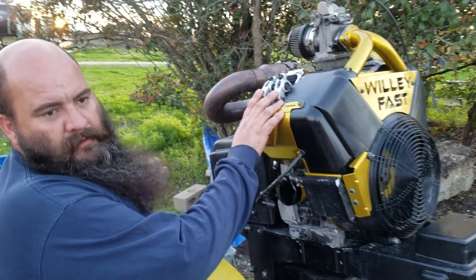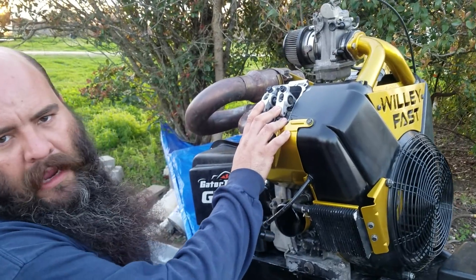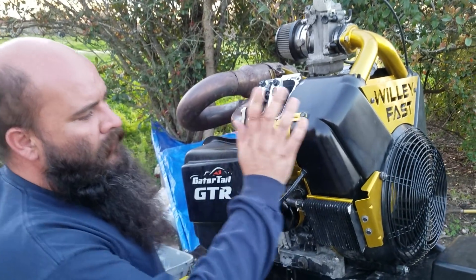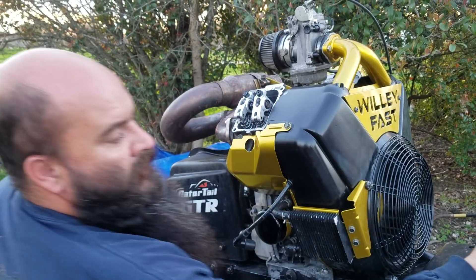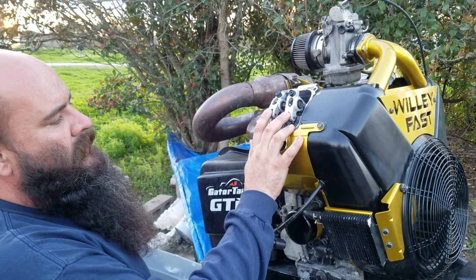What we're going to do is set them off of the cam instead of off top dead center. It's a whole lot more accurate and I'll explain that at the end of the video. So put it in gear, turn the key on, roll the prop in the correct direction because it's going in the water.